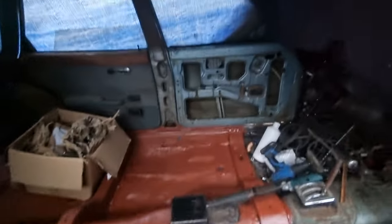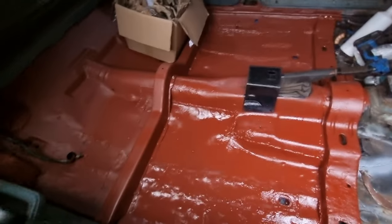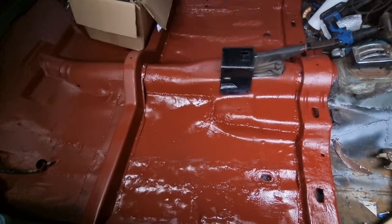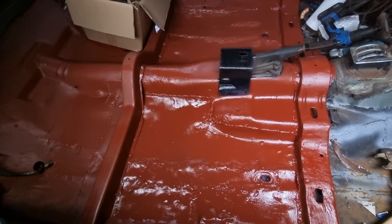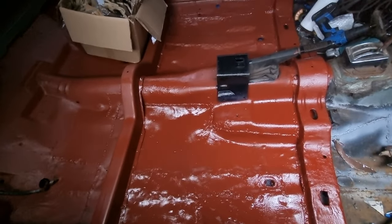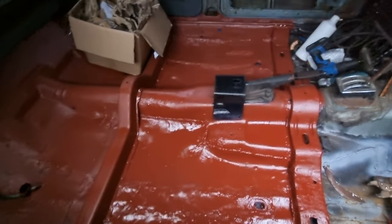But that's where I'm at - back door shuts, but the bottom corner needs to be brought in slightly, hence why I haven't made anything official yet. The good thing about this Red Oxide Primer is it shows where I need to grind my welds down, and then I can re-overcoat. I'm also going to be doing the underside as well - rust treatment underneath and Red Oxide Primer.